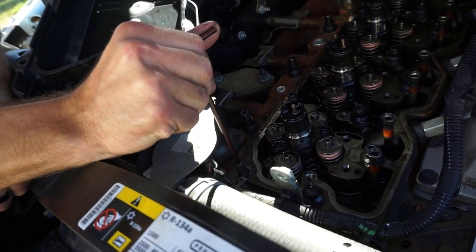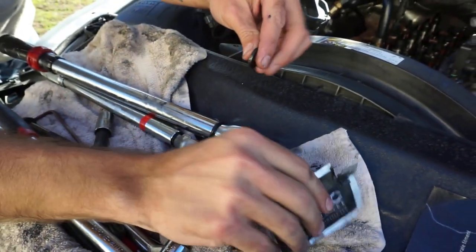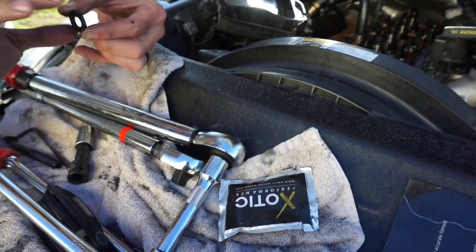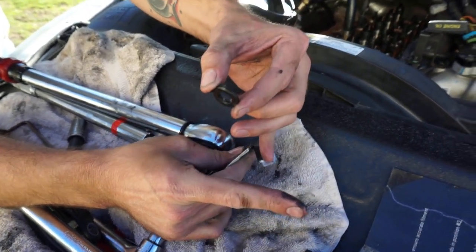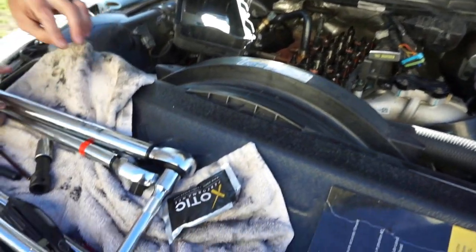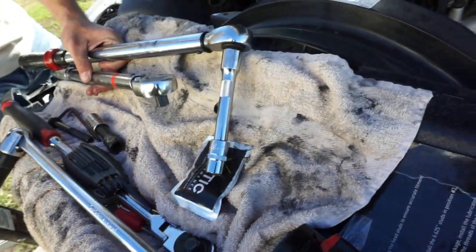He's using the provided Allen screw — Exotic provides everything you need to do this, you just need your own ratchets and torque wrenches. He put a little lube on both sides. The whole name of the game is when you're torquing these down you don't want any drag. Putting them in dry can cause drag on the nut which leads to a false torque reading. By putting that assembly lube on there, it ensures the torque wrench is actually torquing the nut correctly. One by one it takes a long time, but you're saving about six or seven hours of mechanic shop labor — roughly $700 to $800.